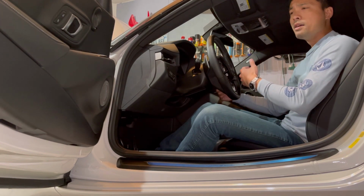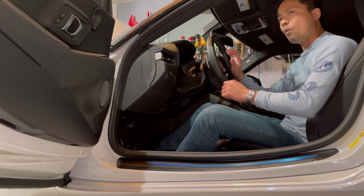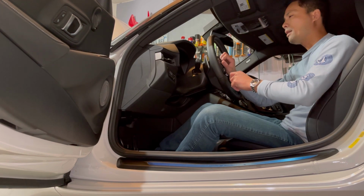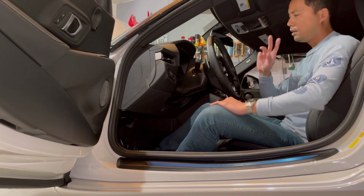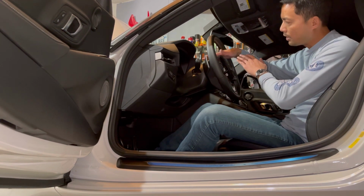After that, remove your flathead. As I said, once you feel the click and you feel the airbag give, pull out your flathead, that way it's not intruding in the space, and pop it out. After that, you just gently pull it out. You have 2 wires to unplug. If you don't want to unplug the wire, you can set it up here in place.